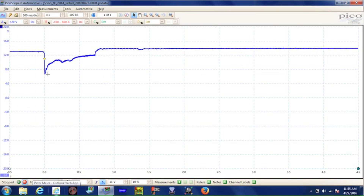The difference is what we got as a loaded voltage reading — that fully loaded reading you see here. Remember on the multimeter it was marginal, around nine and a half. Here, it's actually measuring 6.64. That's way low. The reason you're going to see a much lower value here is because it's the inrush voltage — it happens so fast. This is the drop that happens when we turn the key and apply current to the starter, trying to get that stationary mass of the engine moving. It happens over a very short time. Nothing less than 8.5 is acceptable, so that 6.64 reading is proving what we saw with the multimeter — this battery is definitely in need of replacement.